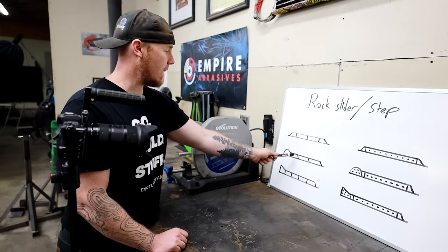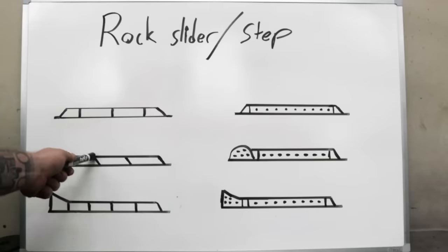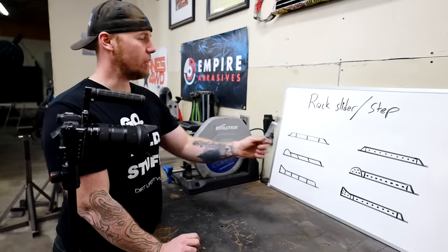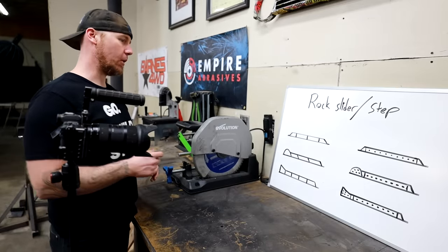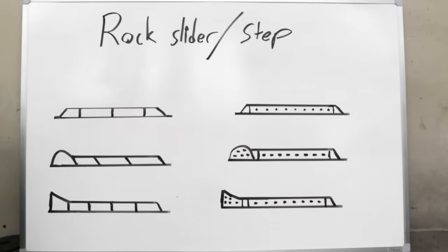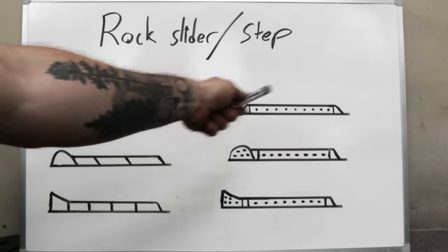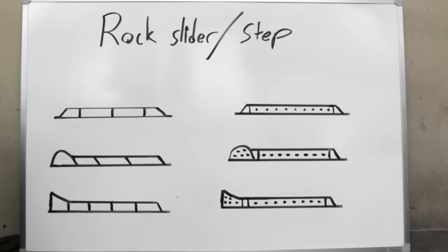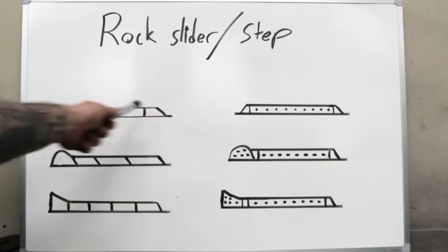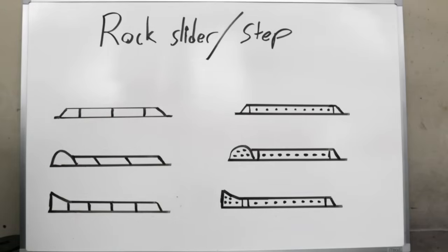This angled style still has the little chunks of tube inside to give it center support. About 10 years ago, I started to see dimple dies just explode in popularity — dimple dies have been around forever, but this style started to blow up big time around a decade ago. Instead of having little chunks of tube, you use a chunk of plate — it doesn't have to be thick, I usually use eighth inch — and you drill holes in it, punch some dimple dies through there, and it looks awesome. It's super off-road, really functional as a step, and still super popular today.